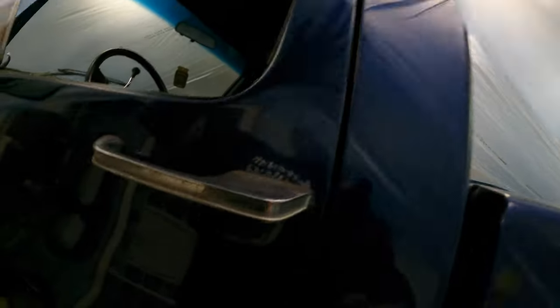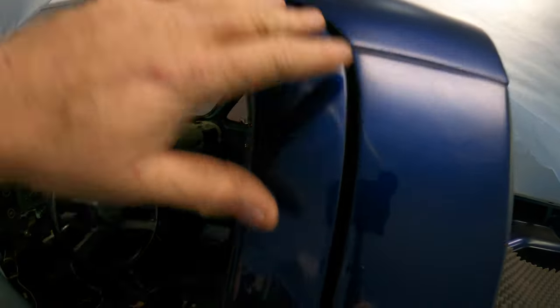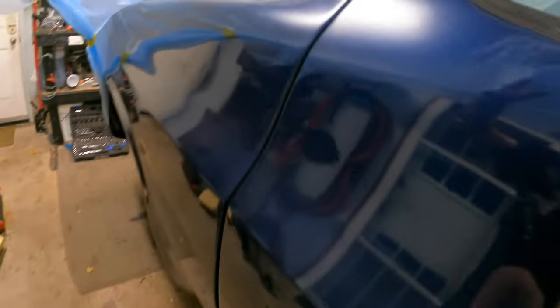Look at that shine right here — what a nice paint color, that's what they call Toyota Blue. It's got a new gas tank as you can see, and Mike also shortened the frame one inch to bring this gap in tighter, because the square body always had a huge gap. With one inch brought in, the box fits tighter to the cab. All the body lines are mint — he even shaved and took off the drip rails. This thing is straight, man.